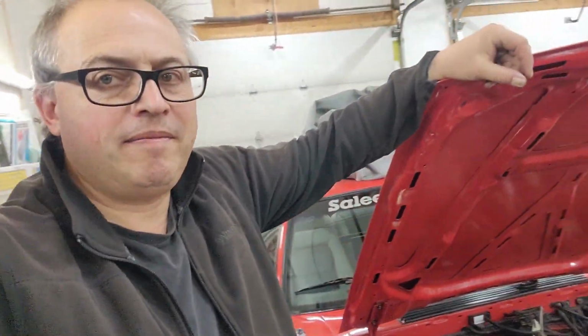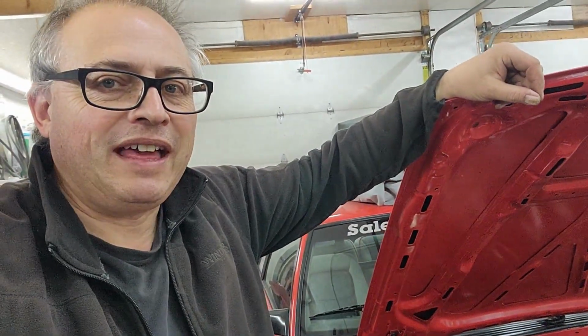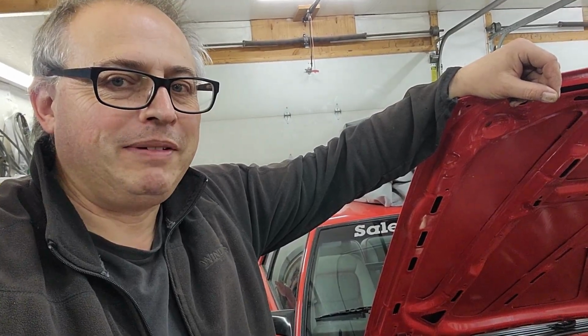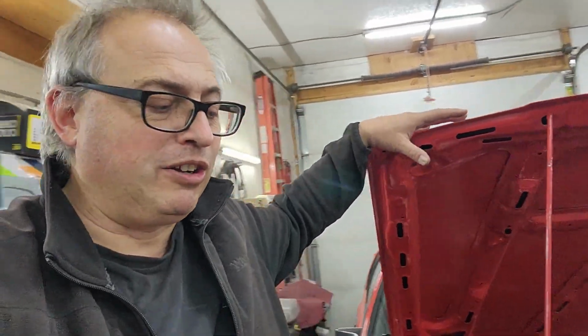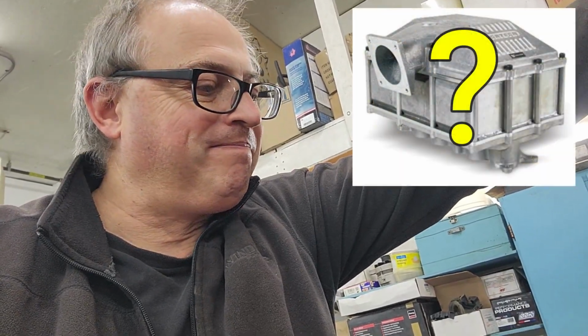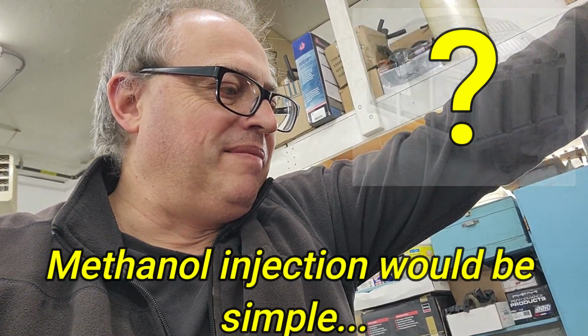It looks like we're going to have to rethink this. Thank God it's November, because if it was March or April, I'd be sweating. Well, it wouldn't be getting intercooled, that's all there is to it. Are we going to have to go to air to water? It's a possibility. Or think of some other plumbing. Like, I don't want to have miles of plumbing under the hood of this thing.